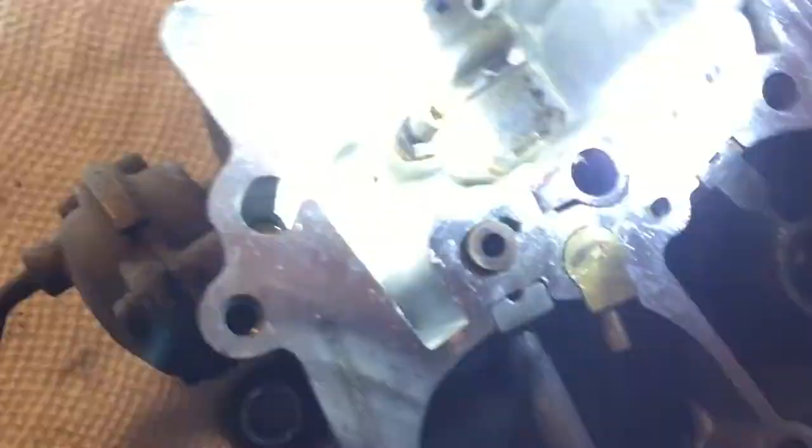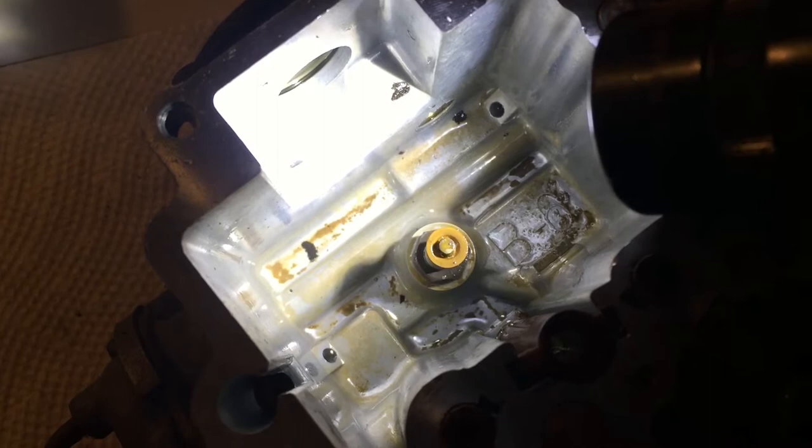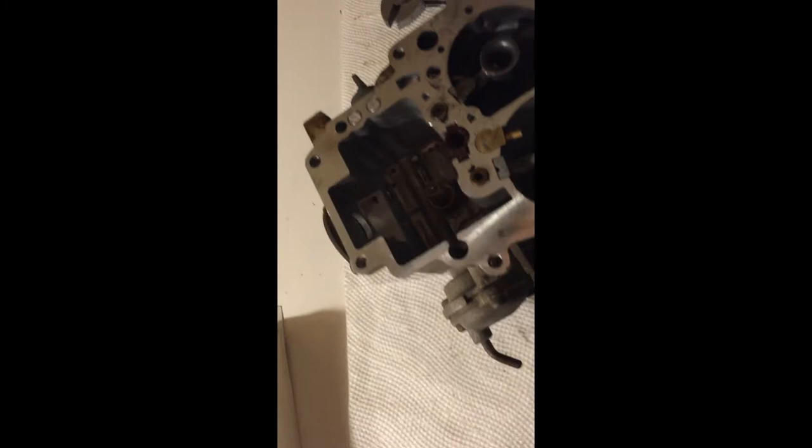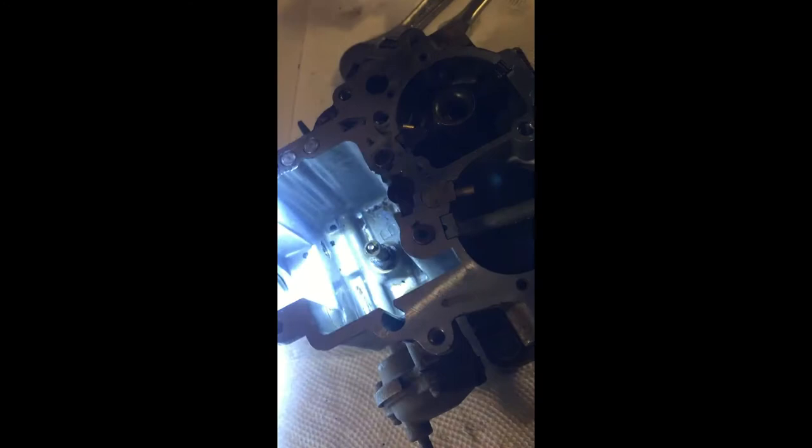You've got to hold the shaft steady, rotate that little top plate around 90 degrees clockwise or counterclockwise — whatever direction it goes — and it'll pop off. Then you can remove the power valve. I don't think I have a deep well socket in the house — there's a 10 millimeter down in there. Off course, Toyota makes me find a deep well 9 millimeter socket.